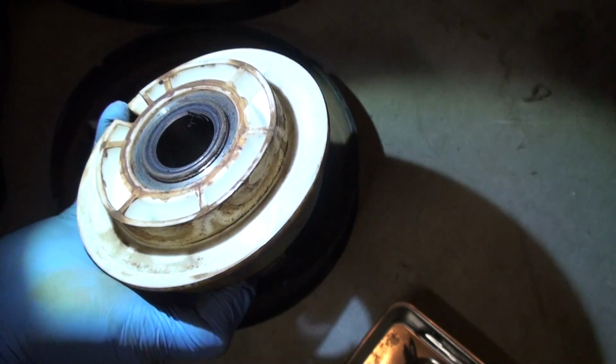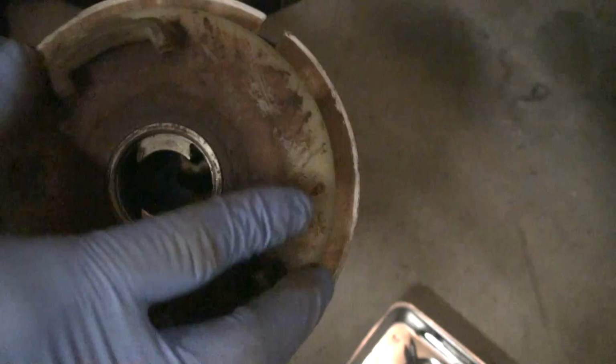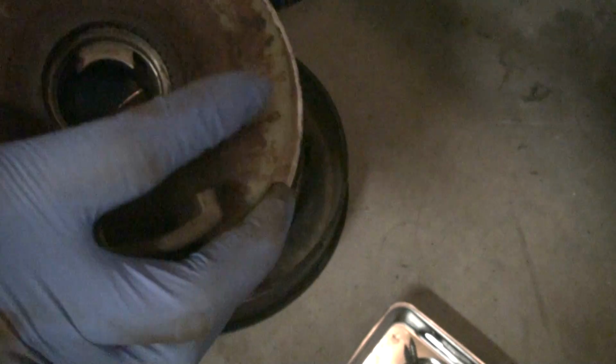this thing. So what you're going to do is remove the center bearing and then regrease it. We're just going to slide this top part off, and you see there's a lot of resistance. And you can see there's no more grease in here. It's completely gone. These little roller bearings in here. So I'm going to clean this all off as best I can, and then I'm going to repack this inner bearing with grease and slap it back on, and we're back in business.